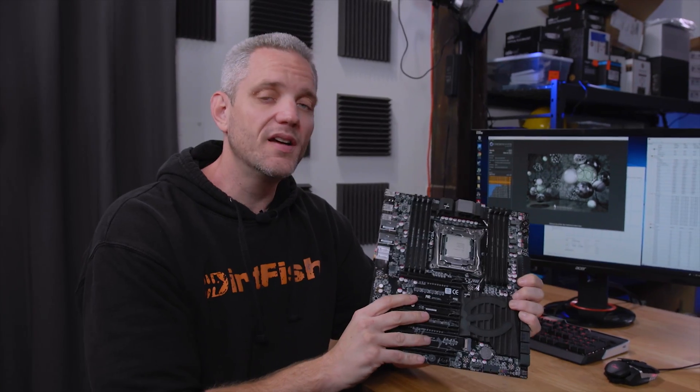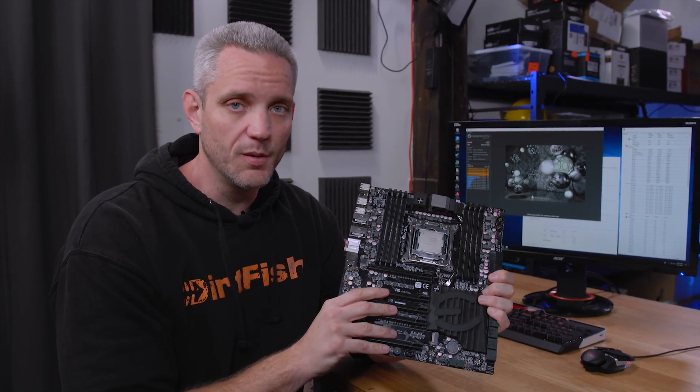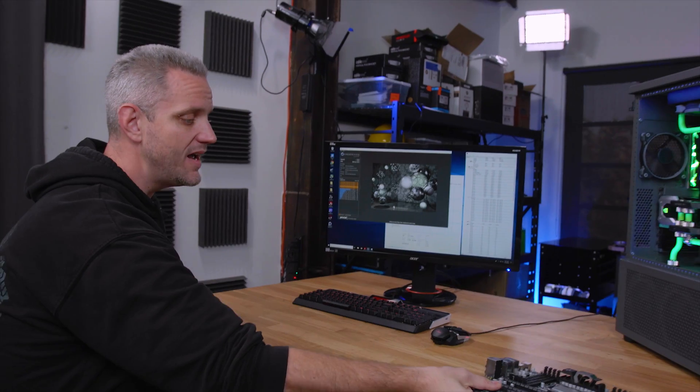This was amazing on temperatures, it was an amazing overclocker. But now that I've got a 7960XE in here, I am dealing with some very funky temperatures that has probably forced me to have to de-lid now. So that's what we're gonna do today — we're gonna test before and after. Certainly not the first time anyone's done de-lidding on YouTube, but it's gonna be the first time I'm officially showing you guys, with the exception of the live stream we did with the 7980XE, and we're gonna see whether or not it's worth voiding that warranty.